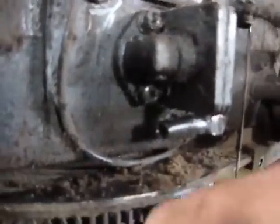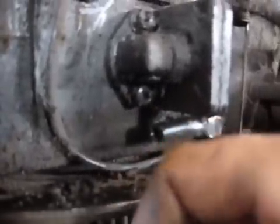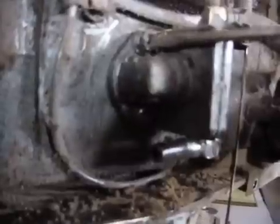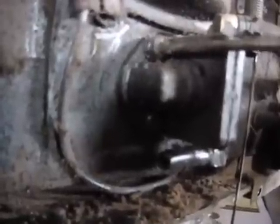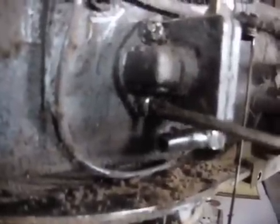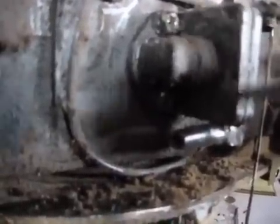Okay, I've got that side mounting bracket removed. It's right there right now. Tray, like I should call it. I'd like to point out something on the fuel pump that people who own these Kohler engines should know. As they age, you should definitely check these screws. They're Phillips screws. All I have is a slotted screwdriver, but this is enough to demonstrate it. See that? It's loose. Both of them, I'm sure. Yep, they're both loose. I had this problem on my 1977 210. These things here loosen up over time from vibration, and you have to check them. Make sure that they don't loosen up.